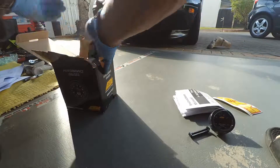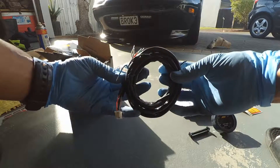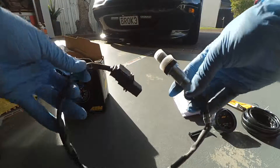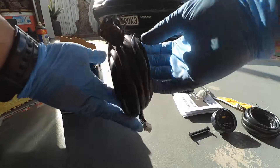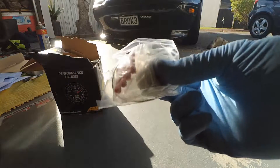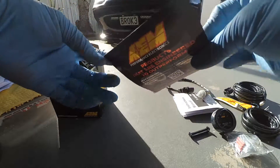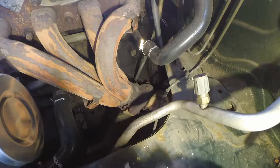There are more stickers, and one of the cables that goes behind the gauge — it looks like it routes to the Megasquirt or the ECU. We've got the aftermarket Bosch oxygen sensor, and the other loom that goes into the sensor. There's a welded bung with some crimp tools and a rubber band, but I don't think we'll be using that because we're going to replace the old narrowband oxygen sensor. There's also a pamphlet. The oxygen sensor already has some anti-seize and crush washers on it, which is good, and we'll put it onto the exhaust manifold.